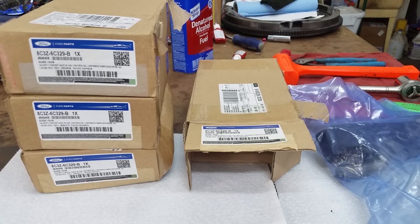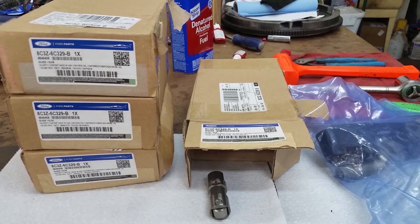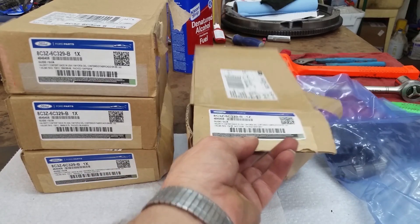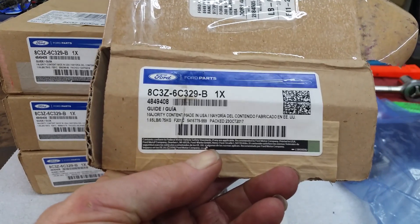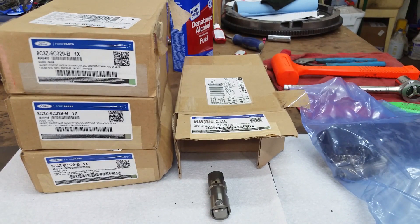So you go online and search for a Motorcraft lifter and you'll get all kinds of stuff. If you look for a Motorcraft lifter for a 7.3 you'll get a part number. The great thing about this is they've used the same lifter from the IDI 7.3 all the way to the 6.4. So using that knowledge, if you go and look for lifters for a 6.4, which are more recently out of production, you'll get this number - Ford Parts Giant - $58 for four of them, so it comes to about $250 for a full set.